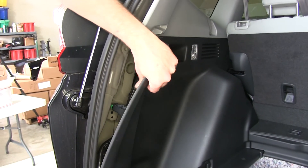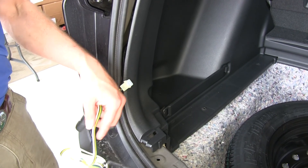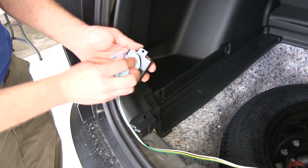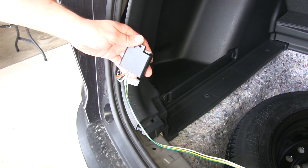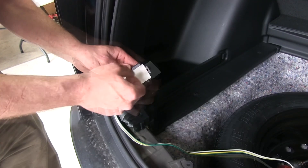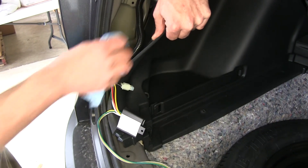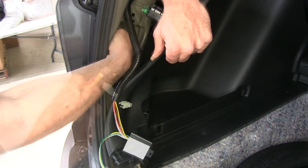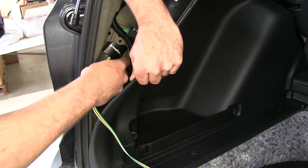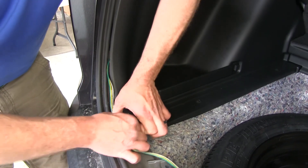Now we're going to tuck our wiring in close to the bottom — you can see we've got plenty of four-pole connector here. There's a little cubby hole right over here we're going to connect to, so straighten this out; it's going to come out right underneath this edge. We'll take the back of the box and use some rubbing alcohol to get any oils off of it, then grab the double-sided foam tape, get that put on the back, and peel it off. Right in this area there's going to be a little pocket — clean off that flat surface, tuck the wiring right in there and get it secured. Tuck any excess wire loom down out of the way, then bring the four-pole connector down and out the bottom.